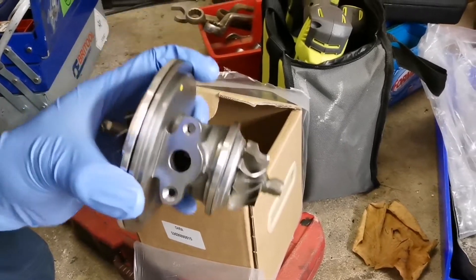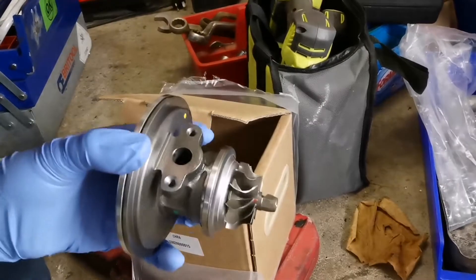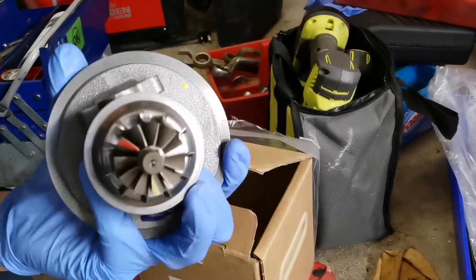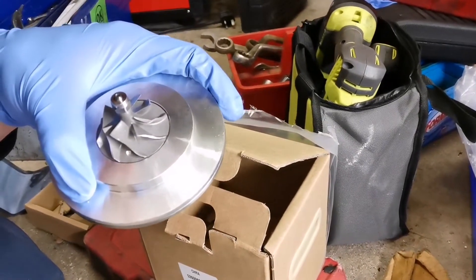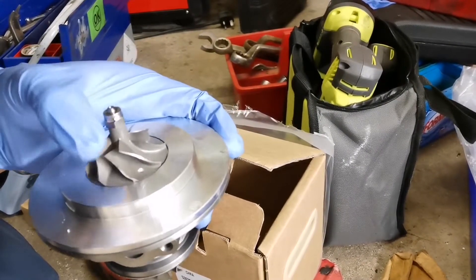This is very small — turbine engines are a hell of a lot bigger than this for the most part. This is basically the bare rotating assembly with the oil ports. That part there is the turbine, and that part there is the compressor. It spins at around 150,000 RPM as I said, and that's all ready to go. What we'll do is I'm going to put this back in its box, and we're going to take the old turbo off the engine, and I'll show you what the damage is and how I remove it.